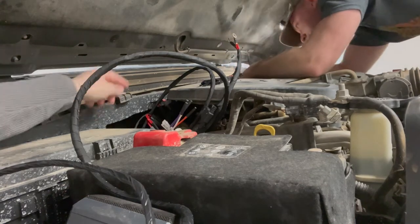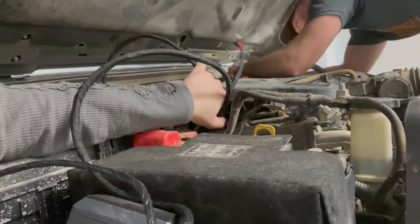When this axle comes in, only the front is going to have a locker. We have the limited slip in the back which doesn't have a locker in it. I'm not quite sure when we'll be getting that — when we move in a few years we'll probably try to find a used one. That's the plan, and then we'll have to wire that from the rear up here, but we will already have the switches wired so it will be a lot easier.